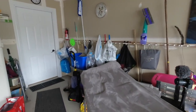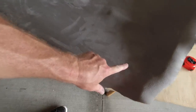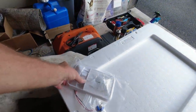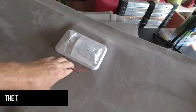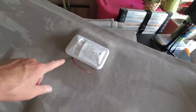The headliner has been sitting since yesterday, so everything looks good — I don't see anything that's a concern. What we're going to do today: we've got to put the holes through here and here — that's where the sun visors mount in. I've got to pop a hole through the middle right here for the wiring. This is a new dome light that I'm going to be installing. I found one that was a good size to match the size of this little raised area, this hump. It's a two-element, so I'm going to go wire this thing up just to see which wires I'll be using up in there.